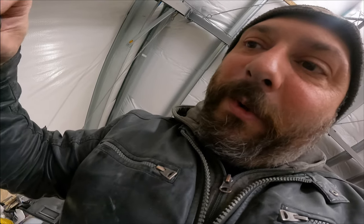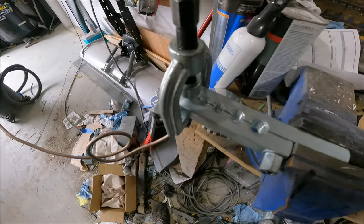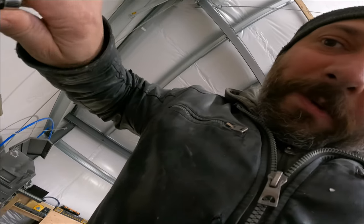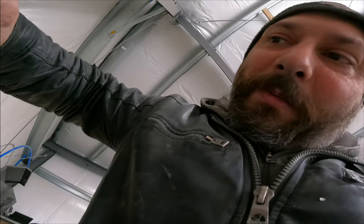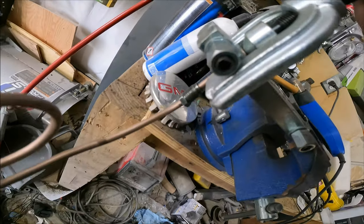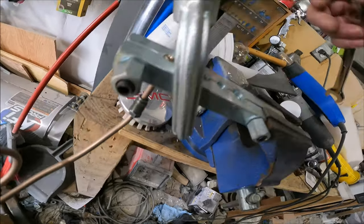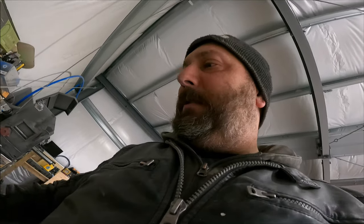That gives you just a single flare, but since we're doing brake lines we're doing a double flare on these ones. So now we take the press — whatever you want to call it — and snug it down, which pushes the inside of that flare down to create the double flare. Snug it up a little bit — that's all you need. You don't need to go hammering tight, you don't need an impact gun — and that should give me a decent double flare fitting for the brake line.